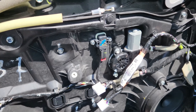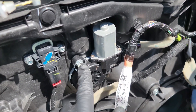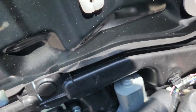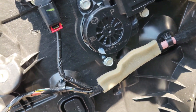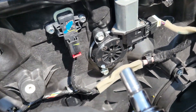So to replace your window regulator — which is this right here — what you do is open these three 10-millimeter bolts. You take it out from here, this one right here. Squeeze that out of there, and you just take out the 10-millimeter bolts to get out the motor. You come in with a 10-millimeter socket.